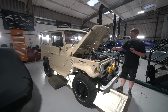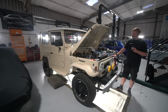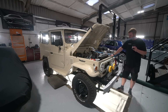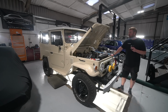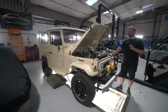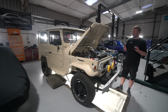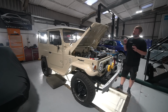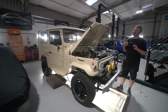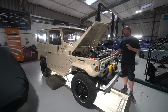So we spoke to ATL, because if you look at the available fuel filler hoses, most companies seem to sell more or less the same thing. They said that yes, sure enough, there is a problem at the minute with E10 fuel permeating a lot, because of the ethanol content, through rubber fuel filler hoses, and there isn't an obvious solution. A lot of the old type fuel filler hoses are getting fuel smell permeation, and the culmination of this advice was that if you get Viton lined hose you won't have a problem, but Viton lined big diameter fuel hose is not actually that common.